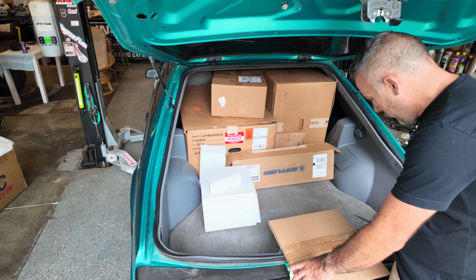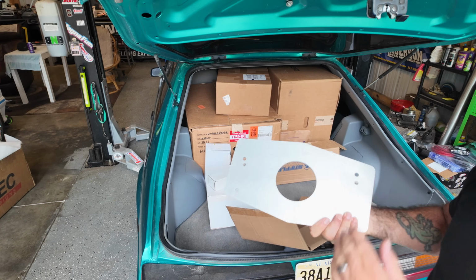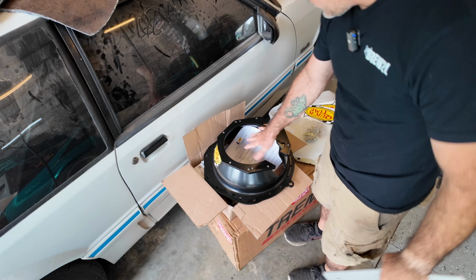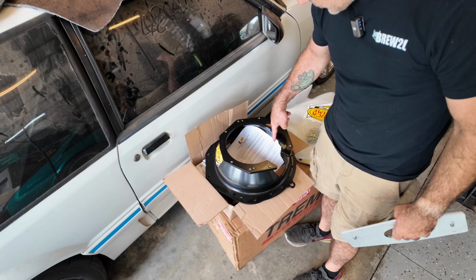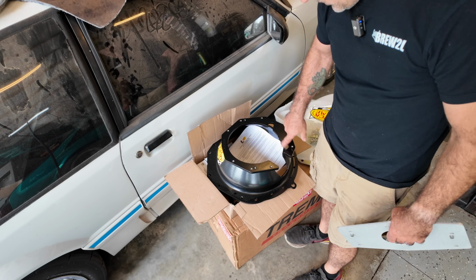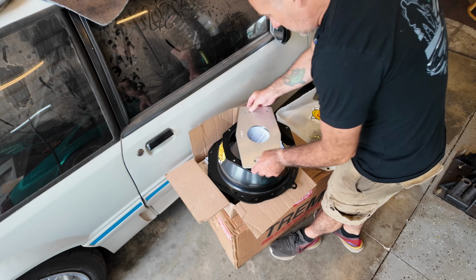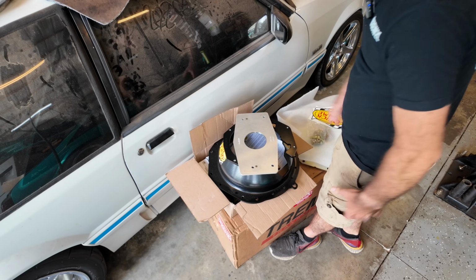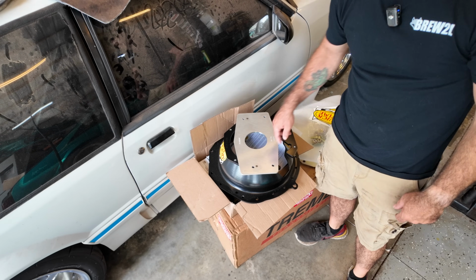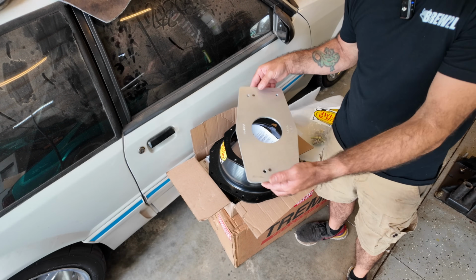Let's talk about this QuickTime bell housing for a second. This is your index plate for the bell housing. You stick your dial indicator through here and you're trying to run this thing around. That's not gonna work. You got a big opening here. So I think this is gonna go, yeah, like this, right? So now your dial indicator will run across this. All right, so that's all that is. Once you're done with this, you just put it to the side.